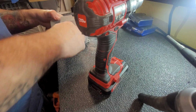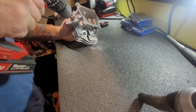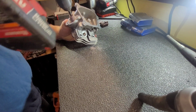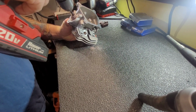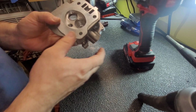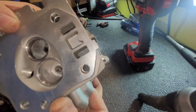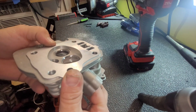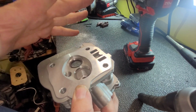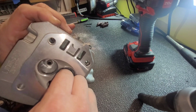Oh yeah, she's looking nice. Just gonna look at that roof a little more. Looking pretty good in there. She's gonna flow nicely. They hit the valve seat a little bit, but I always regrind the valves in anyhow, just in case. We'll be okay there. I've done worse. It happens. It's looking good.